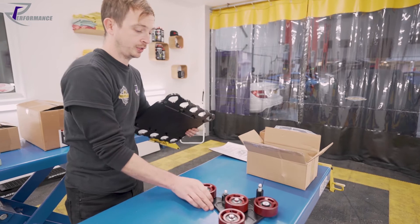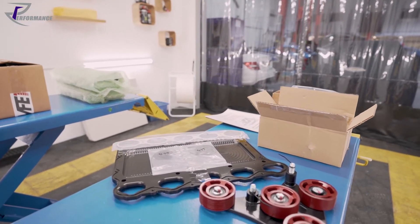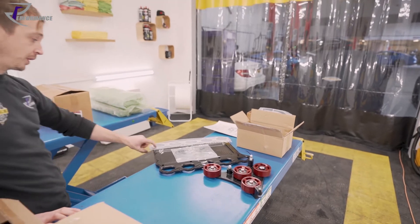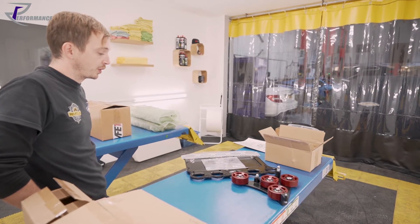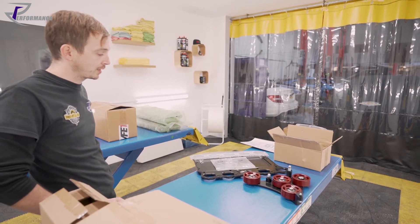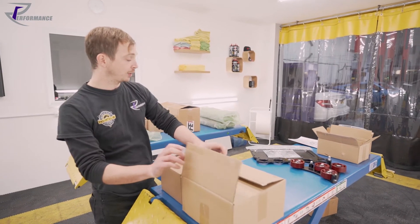This is the base plate for the supercharger. We take the inlet manifold off complete, do some modifications under the inlet manifold, and then screw this down onto the lower inlet runners. A nice little piece that they've started to do — we see quite a few people struggle when they boost their rates, and it's something we do on our turbo kits — but these stop the rubbers blowing out when you boost them, because they're not a conventional gasket, they're a square end seal. It's nice to see that they've continued their development and included this in the kit.